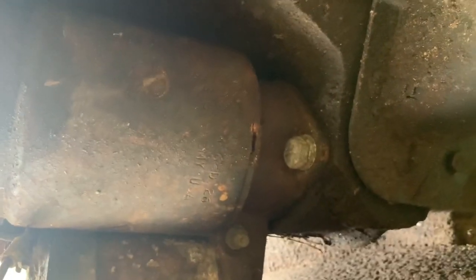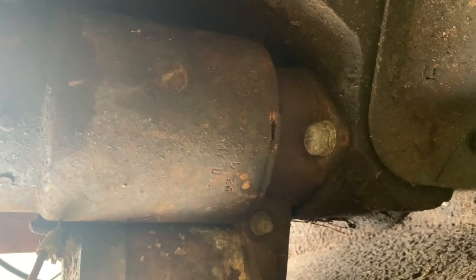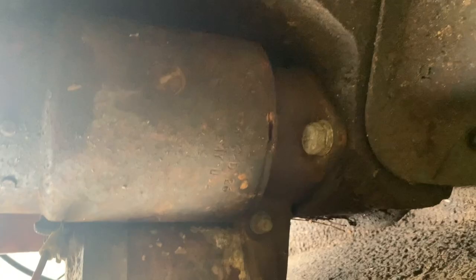You can see there is the top mounting bolt for the starter, and then up underneath the Scout there's the lower one. Just like I figured - just a couple mounting bolts. Pop them off and we'll have this starter out.